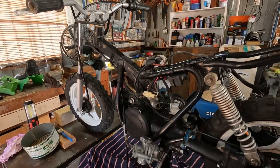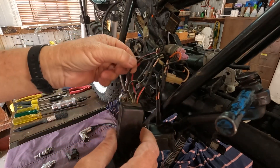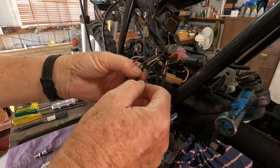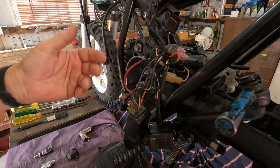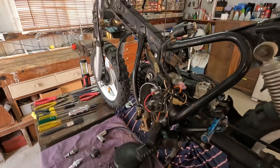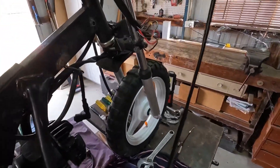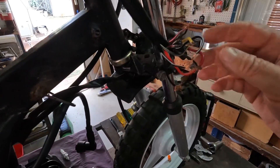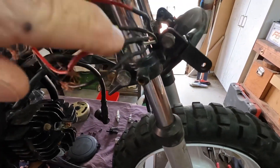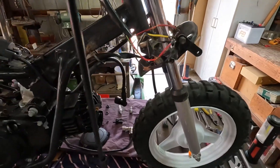That's what it looks like at the moment. We've stripped it down pretty well. I've just finished taking the tape off around these wires, and the CDI unit and the control unit — it appears that they've been bastardized. These wires have been cut and rejoined at some stage, maybe twice. They should have connectors on them. Then I went around to the other side of the bike up near the handlebars and had a look at these wires — they're all taped up and they've all been cut at some stage, joined here, and then cut and joined back up here again. So the wiring job on this is not real good.